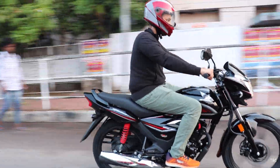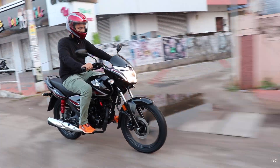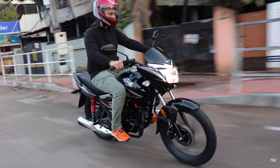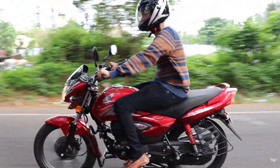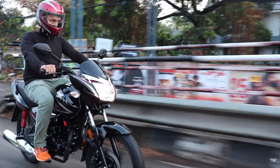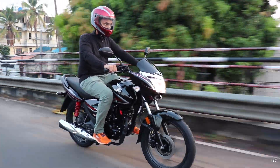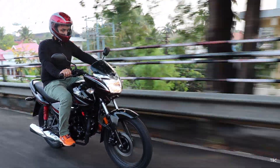On the road, I did notice a change in suspension stiffness and liked the new setting, which together with the other improvements provides slightly better ride comfort on the BS6 Shine. The improvement is also noticeable with mileage — both versions have a 10.5-litre tank, but in city conditions the BS6 Shine returned 64 km/l while the BS4 returned approximately 57 km/l. That's a good increase, mainly due to the new engine and also because the BS6 Shine is lighter, weighing 115 kg compared to the BS4's 123 kg. The ground clearance has also increased by 5mm to 162mm on the BS6 version.